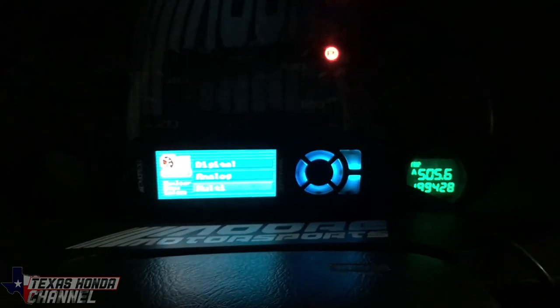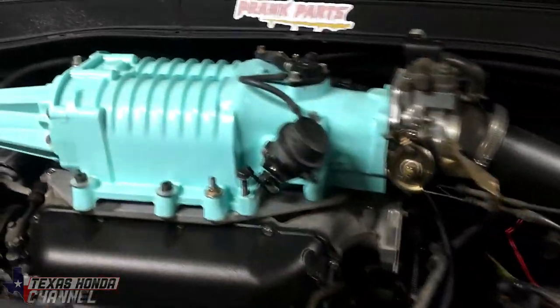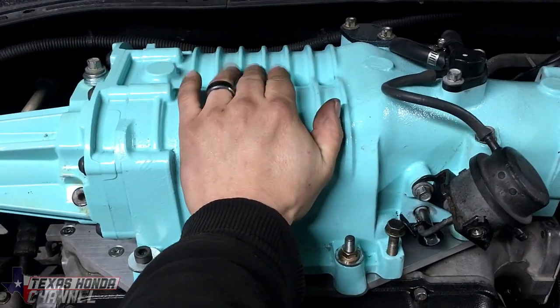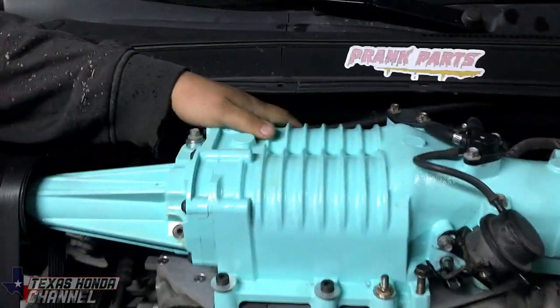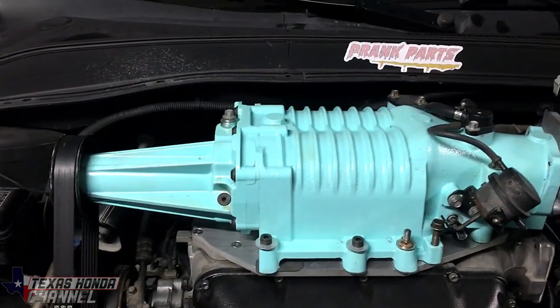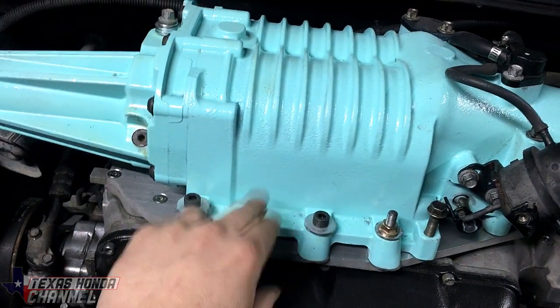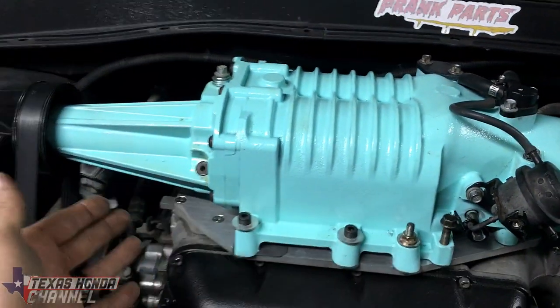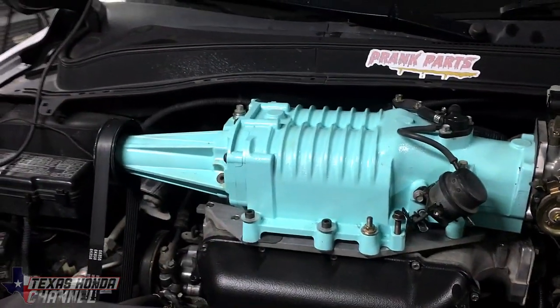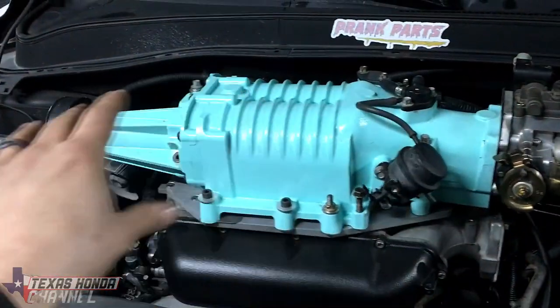It's running fantastic. The supercharger is actually not very hot at all — just a light warmth. Most superchargers you could cook an egg on — like the D-Series Jackson Racing supercharger, that thing gets hot. This one not so much. They make an aftercooler that bolts right below the supercharger and the adapter plate — basically an intercooler setup. They make them at ZZP Performance — look up parts for the Pontiac Grand Prix GTP on their website.